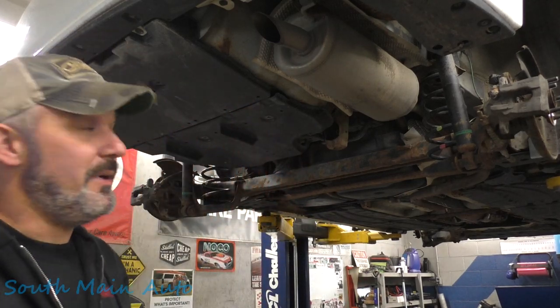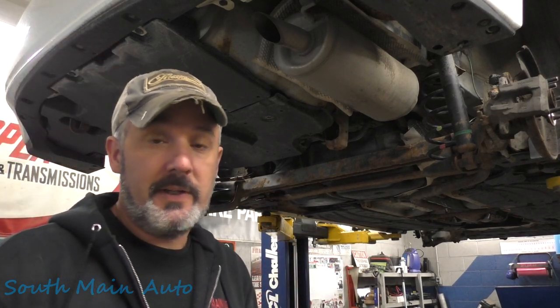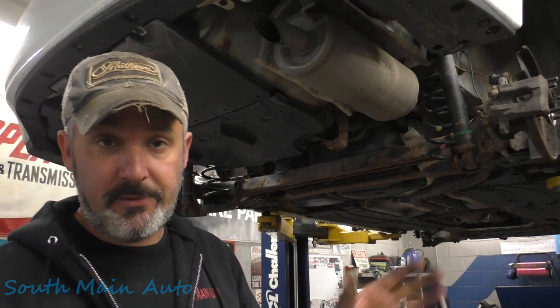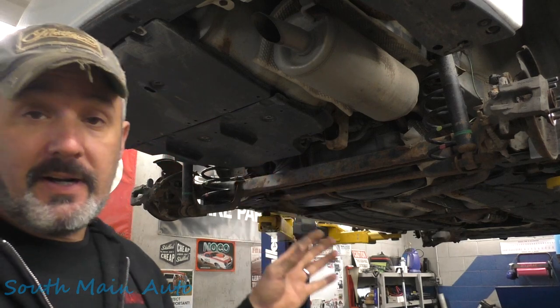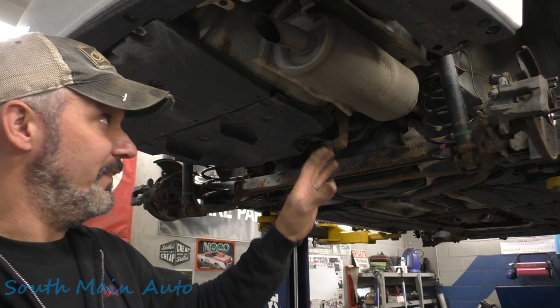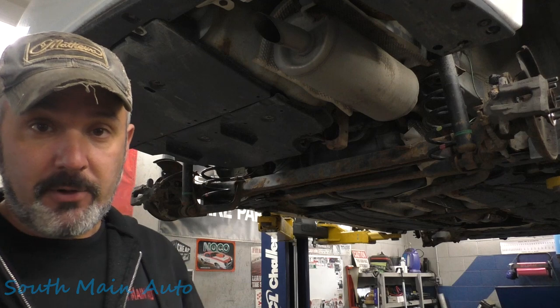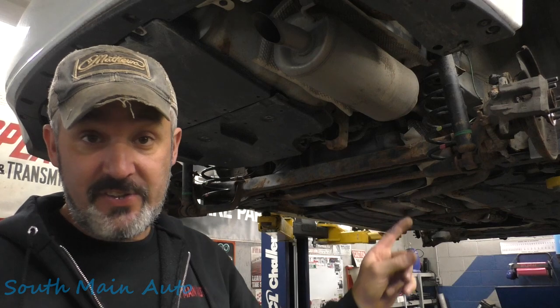So you've got to be careful though. Active wheel speed sensors can be quite difficult to diagnose with a scope. Scoping a good active wheel speed sensor, piece of cake. They're super easy. Toyota is not a great example because Toyota has a very logical, practical setup where it doesn't disable that circuit when there's a fault. Now, when you're working on a lot of the domestics, cough, cough, GM, Chrysler, they will typically kill that entire circuit when you set a code.